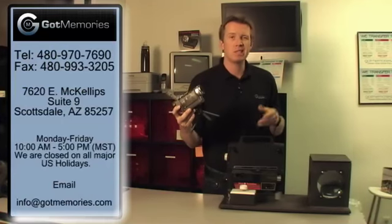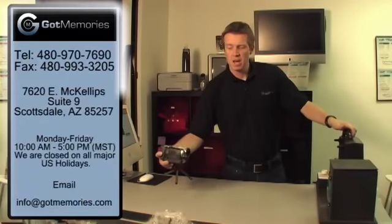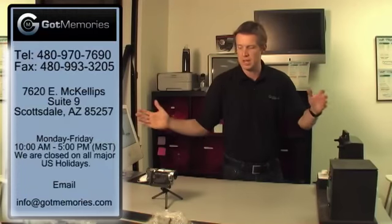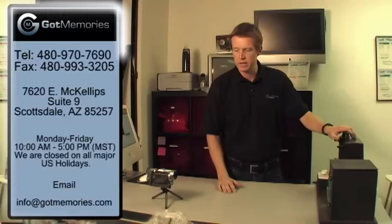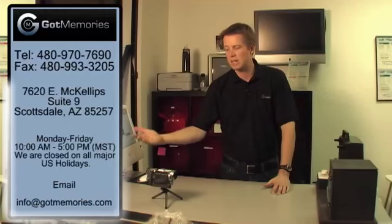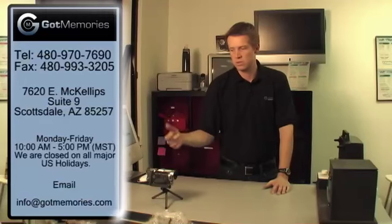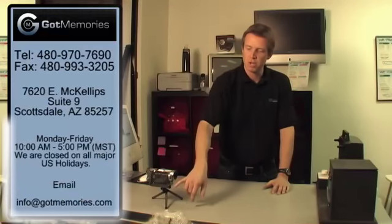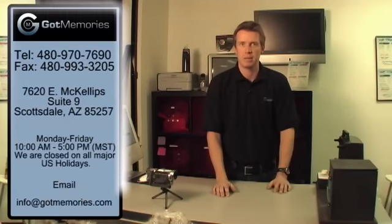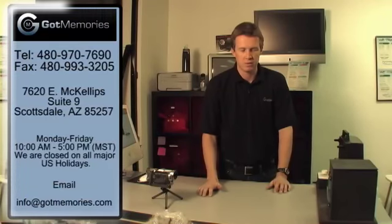And this camera, this is kind of the weird bit. The camera actually has to be, and I'm going to turn this to give you a visual reference, approximately 3 feet away. And we're not quite 3 feet away here because of the angle of the camera we're shooting on right now. I want to fit it in the picture. But to give you an idea, this camera then has to go into a capture device, or it has to go into a computer. And one thing to note as well is when you're recording all of this, the microphone on the camcorder is picking up the audio, the clang of the projector, and you have to eliminate that afterwards. Or you can put a mic jack in there to kind of close off the mic on it.